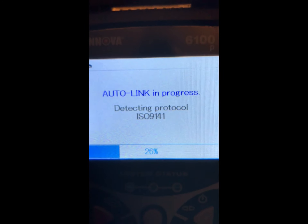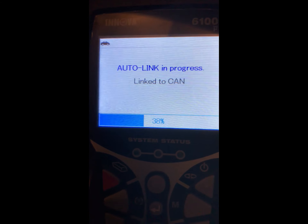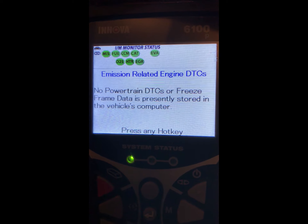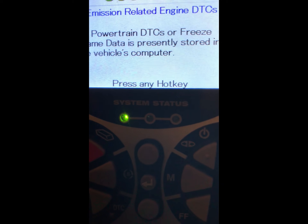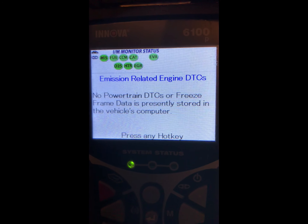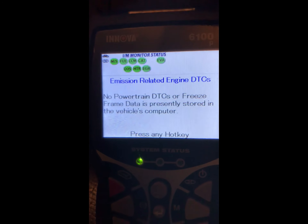You'll see it's automatically detecting, and the neat thing I found out is that it actually comes up with any error codes and DTCs that are already logged. It's got three LED lights — one's green, one's caution, one's red. Red is a fatal error, caution means you should look at your engine codes. So another feature I like is that when you plug this in, it goes through your DTCs right away.